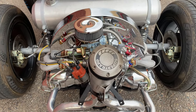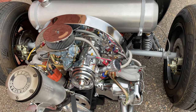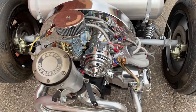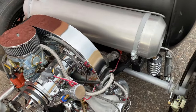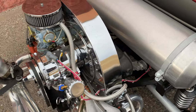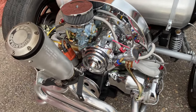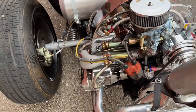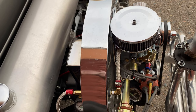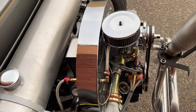You can remove this motor and sell it to anyone who wants it for a Volkswagen bug, a Karmann Ghia, or one of the Porsche 356 replicas — they'll go super quick. The great thing about this is the Kennedy clutch adapter on the transaxle — that will accommodate literally any type of motor, whether it be Ford, Chevy, General Motors, Honda, Subaru, or Nissan. When you start getting into the high-dollar motors like the Corvettes and 350 small blocks, or V6 Hondas, you might have to upgrade your transaxle.